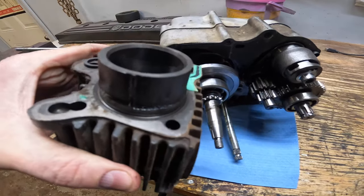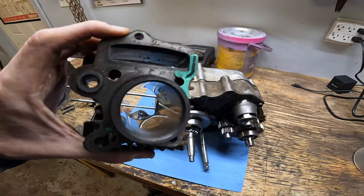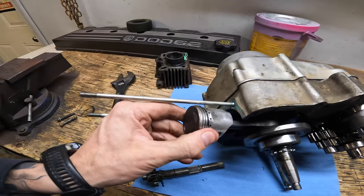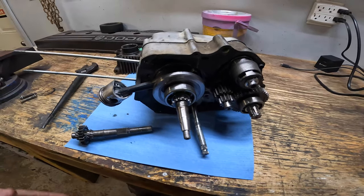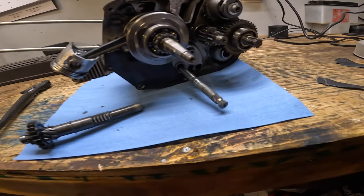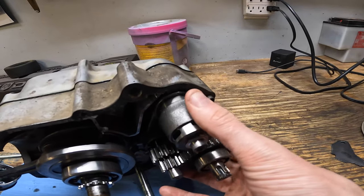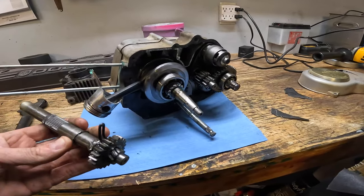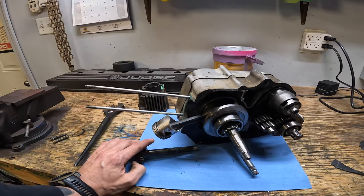The cylinder looks good — you can still see the cross-hatches. I'm wondering if they replaced this, because all the gaskets are pretty good. I'm gonna go ahead and assume the cylinder's probably good. Piston looks good, and for the rings I think I'm gonna roll the dice — put them in, see what happens. Worst case, I take the top end off and replace it. I am gonna replace every other gasket and clean that oil filter. That should be enough to get her back together and see what we're dealing with. Anyway, I'll end it here — next video may be a little while, but it'll be reassembly and then take it for a spin.